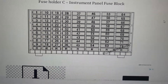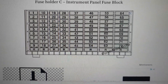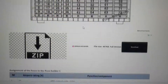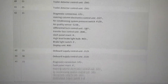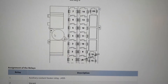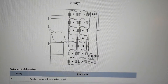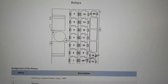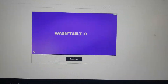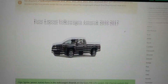This is a typical website. The fuses - you can see some fuses on this side are shown as mini fuses, and then these are shown as midi fuses or normal fuses. That fuse box was incorrect and it gives you some determinations. This relay plate - even if you turn this picture upside down, you can see this shape on the relay plate, but all these shapes are vacant and the amount of relays in the plate are incorrect. This is all the information you can find for the Volkswagen Amarok on the internet.